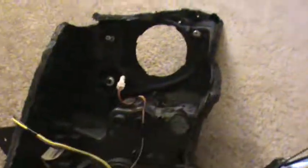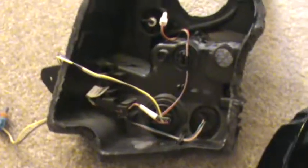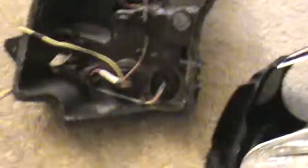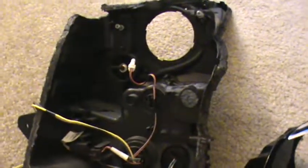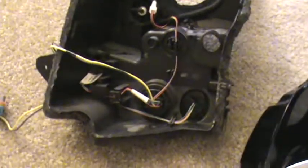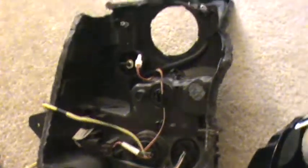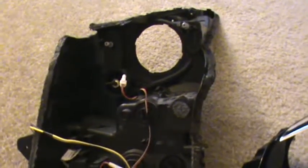So that's where we're at. I said it took me from like 10 a.m. to 4 p.m., but I did take a lot of breaks because it was just really slow going with the hot knife. Once it busts apart into pieces it's fine. I prefer trying to use the hot knife because it's less noise, less mess. When you're using the cutting blade on the Dremel, there's little black plastic bits that go everywhere.